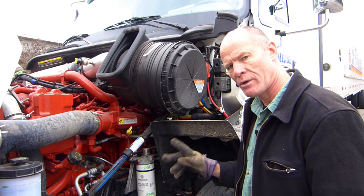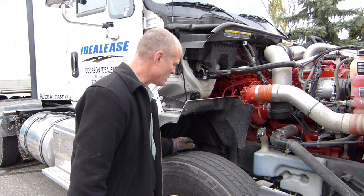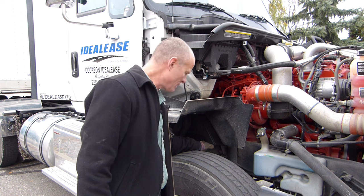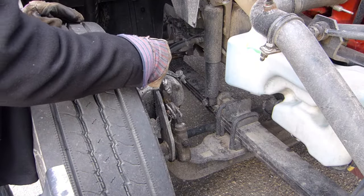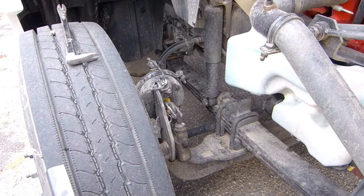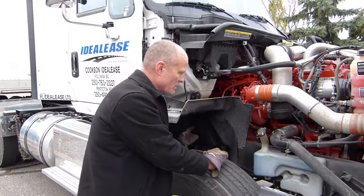We're going to go around to the other side of the motor. On the passenger side of the vehicle, there aren't any air brake components, so essentially all you're checking is the line out to the brake chamber. The brake chamber is secure, not damaged. The wire for the ABS — check that, do your push rod within half to three quarters on the push rod travel for the free stroke method, and check the inside of the hub. There's nothing on the inside of the hub that's damaged, and the lines and wires for the ABS valve back in here are secure, not damaged — all the wires, lines and hoses are good.